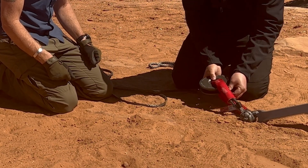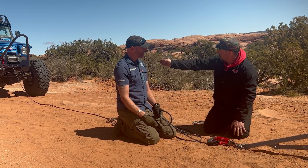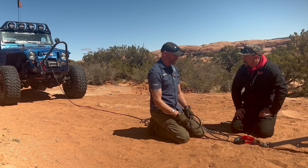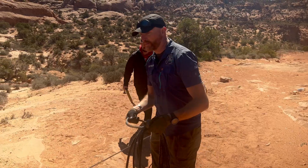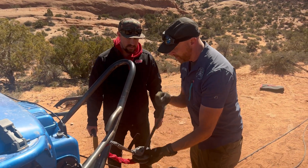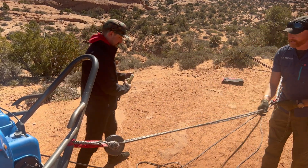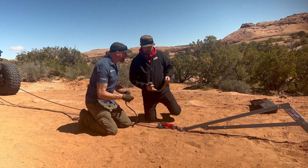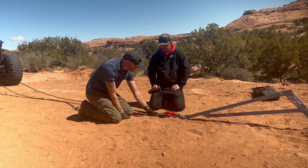If you know where your winch line is, the best way is to make sure you've got your drum and your recovery point on the other side with your winch ring. We're going in the correct direction — coming back, feeding it through the eye, making sure the monkey fist is right there. Now the way I understand it is we run the soft shackle through the center because we're already utilizing the outside, and then it connects right here in the middle.